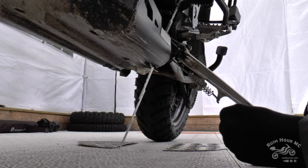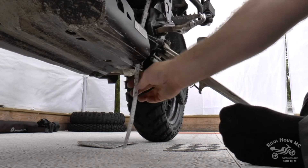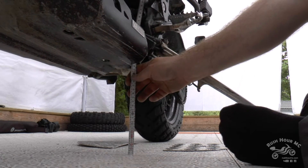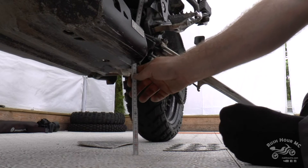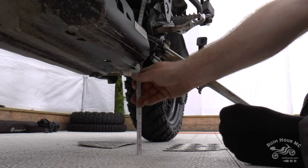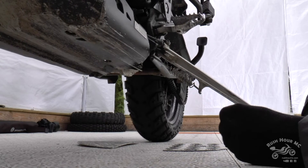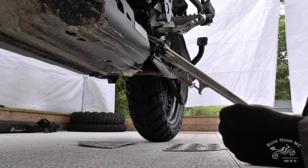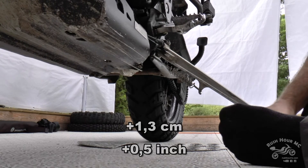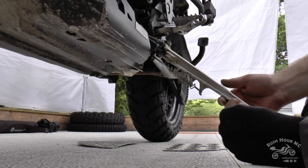Rolling the bike upright and getting it in balance. So this is where it's in balance, and I would say it's two or three millimeters higher from the fork adjustment — it's kind of nothing on its own. But combined with the dog bones we did increase it. It's one centimeter, maybe one and something. Let's say it's half an inch of change in ground clearance total.